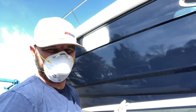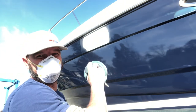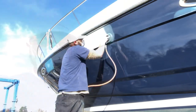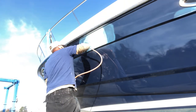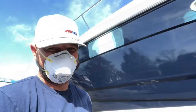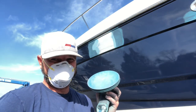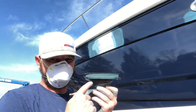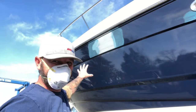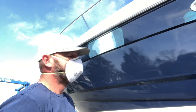320 went smoothly - nothing jumped out at me. Now I'm taking 600 grit and going around the outer perimeter. This is going pretty smoothly and quickly. Now I'm jumping to 1500 grit - interface pad is important for this step - and I'm just going around the outer perimeter where I just sanded with 600.